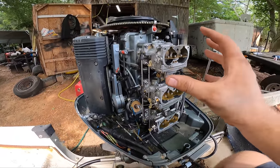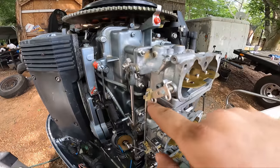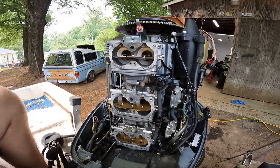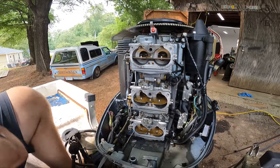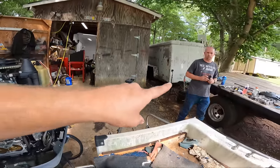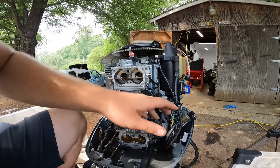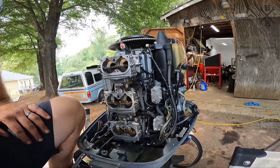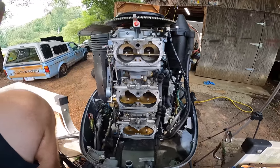Let's go ahead all at the same time. You have four 10 millimeter nuts all the way around. Let's pull all three carburetors and fuel pumps off and get all of those replaced and rebuilt. So I'm gonna go ahead, we're gonna let Rev pull all of these off. And of course you can go check his video out and you'll see those getting removed, cleaned, and reinstalled.